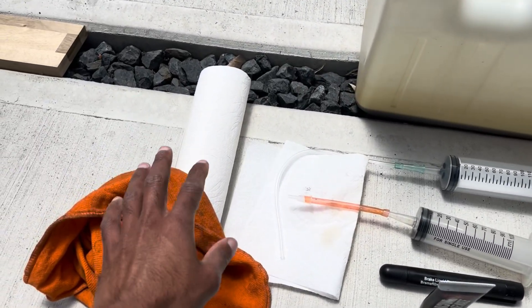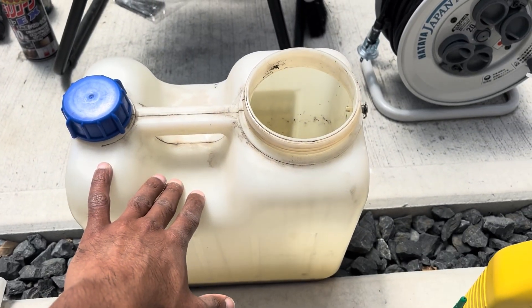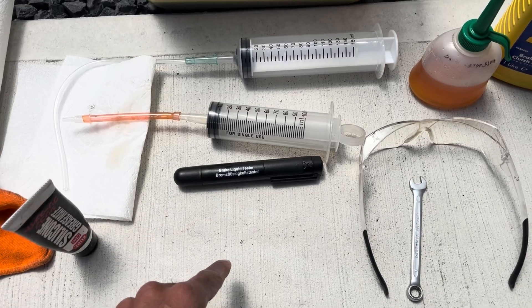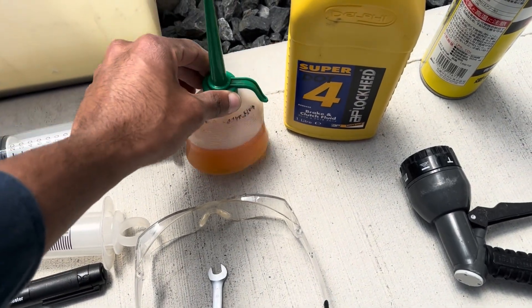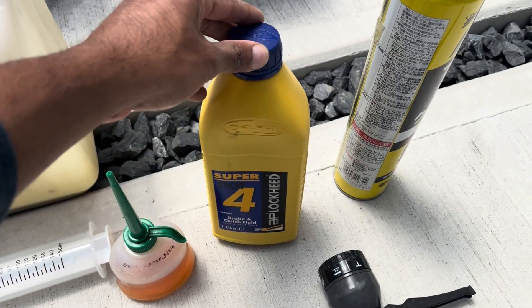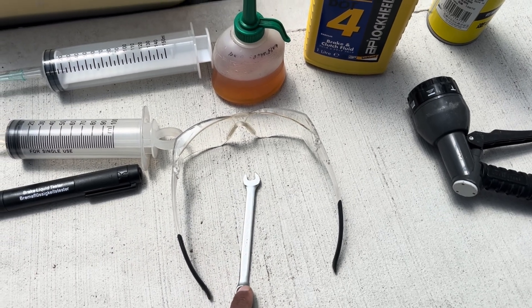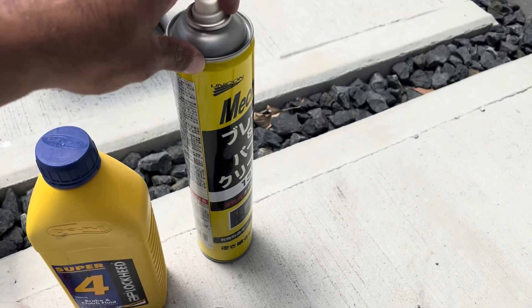Here's everything you're going to need: some rags or towels to clean up any spills — I've got a whole stack of old bath towels. Something to catch your old brake fluid so you can dispose of it responsibly. Two big syringes like these. A brake fluid tester — this thing is super cheap, and anybody who works on their truck, car, or motorcycle must have one in their toolbox. A little squeeze bottle to top up your brake fluid reservoir, already filled with brand new brake fluid. A wrench the right size to open and close your bleed valve. Some safety glasses — super important. Rubber gloves when working with brake fluid. Some brake and parts cleaner. And a water hose. All of the supplies I'm using in this video are linked in the description below.